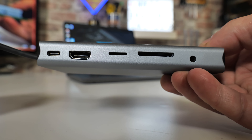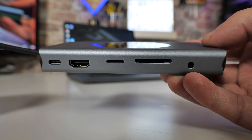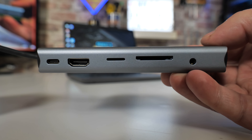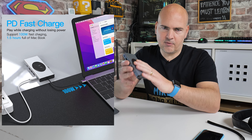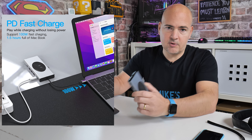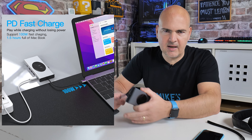This actually has an absolute ton of other features. On this side there is the USB Type-C power delivery port, providing up to 100 watts of power delivery. You can plug in an external power brick into there, and it will redistribute the signal throughout the box and primarily into the cable into your device — so you can charge your iPad, your Mac, all those kinds of things. As long as your device supports power delivery via USB Type-C, no problems at all.